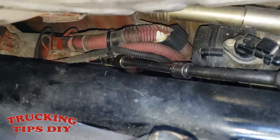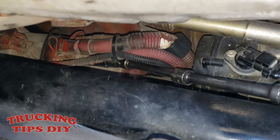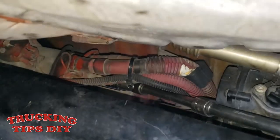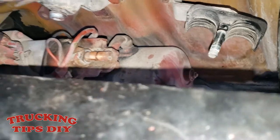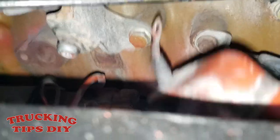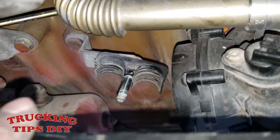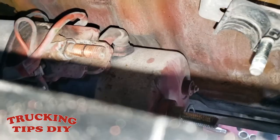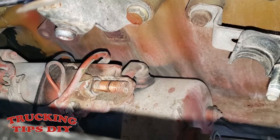As you can see there's a swivel down there. Here I went ahead and removed all the cables — just make sure you remember all the ones you took out. I also removed this bracket right here just so I can have enough space to pull the wires out. Pretty much the starter has no more cables to take off, so now I'm going to start by removing it from the three bolts.